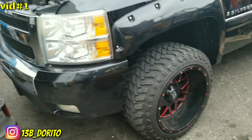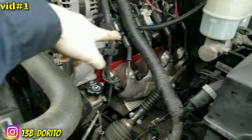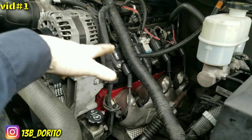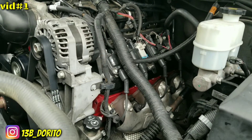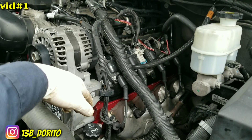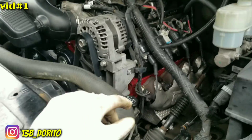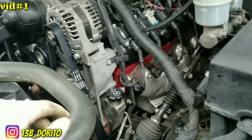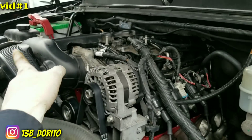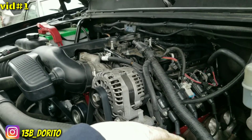What's going on YouTube, I'm here again with a quick video. What we're gonna do today is remove the head so we can replace the lifters because we have a noise. We're gonna install brand new lifters from the dealer, because this engine has been previously rebuilt. Hopefully it's not the DoD, because if it is, you guys already know it's a headache.